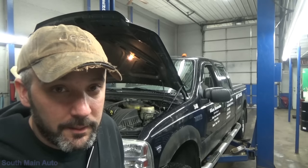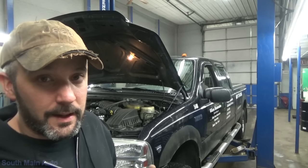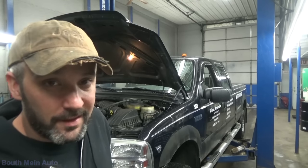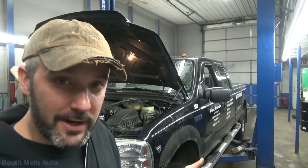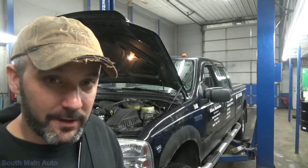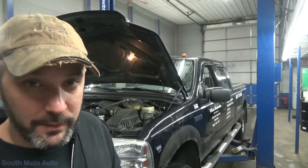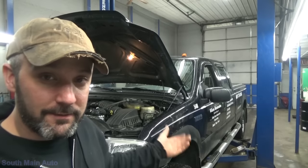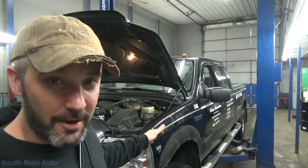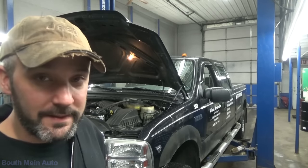I won't have that until tomorrow, but in the meantime the customer wanted me to look at a couple other things, one of which was his automatic four-wheel drive hubs. He says four-wheel drive works, which I know it does because I drove the truck in and out on the front driveshaft. But in auto mode — this is a regular shift-on-the-fly transfer case with two-high, four-high, four-low — you've got lockout hubs on the front with the option of four-wheel drive locked in, or auto. If you leave it in auto, supposedly they won't engage. I verified that: I left them in auto, put it in four-wheel drive, got a little ratcheting sound that seems to come from the right side, but no engagement.